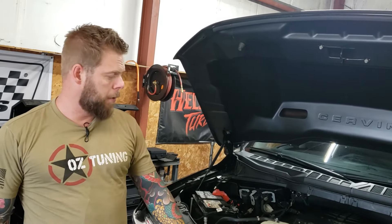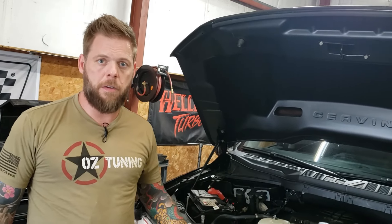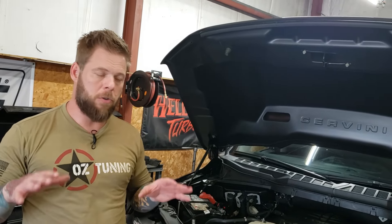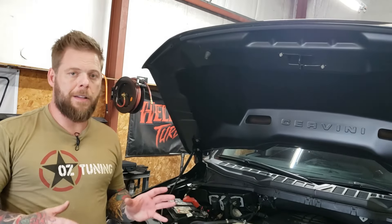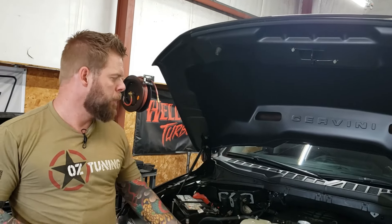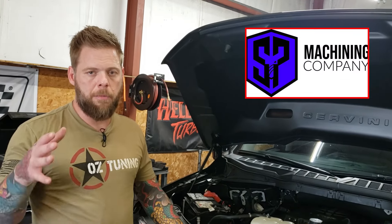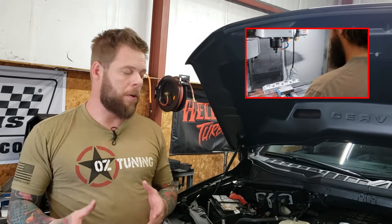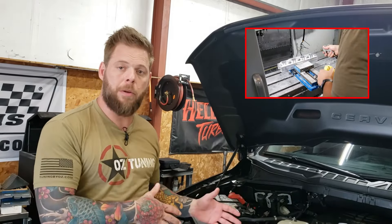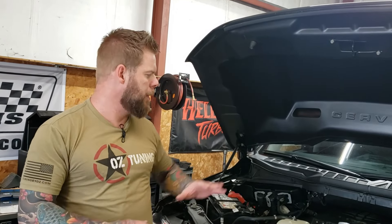The other issue is that the Gen 4 Coyote engines in these trucks are a little different from the Gen 3 trucks in that they have the cylinder deactivation system, which makes the cylinder heads a little taller. Because these superchargers bolt directly to the heads, the clearances are different and everything didn't really fit or line up. So the first step was sending this truck over to our friends at SP Machining — Mark Sheer designed adapters and a few other parts to allow us to adapt this VMP Odin supercharger onto these 2021-and-up F-150s with the Gen 4 engines.